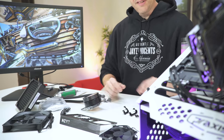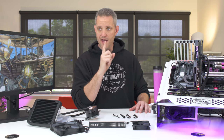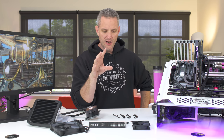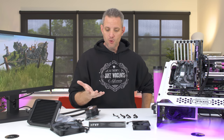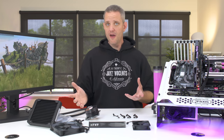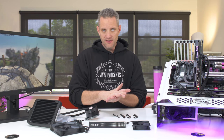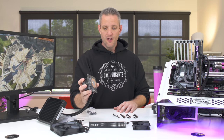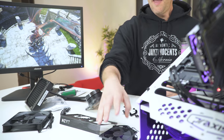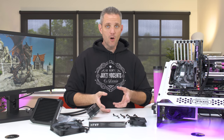Here's what I'm gonna do — install this today on my EVGA For The Win 2, a 1080, which is the first card with ICX. I want to see whether or not we're doing ourselves a disservice with cooling on things like power delivery and memory. Most graphics cards today have heat sinks contacting the power delivery and memory for active cooling. When you do something like this, you only have the pump touching the GPU core, and then a fan blowing down on bare PCB components.